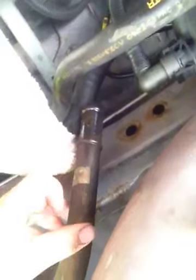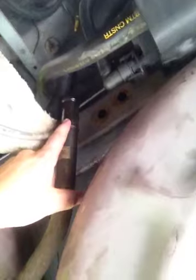If you can jack up the car and get under it, follow the gas line all the way towards the tank, and there's a rubber hose that connects the metal line to the tank. What I'd done is there was a clamp on it, so I loosened that with a flathead screwdriver, and then with a little bit of determination, a screwdriver, and some PB Blaster, I was able to work that hose off, and that way I could access the fuel tank with my siphoning hose.